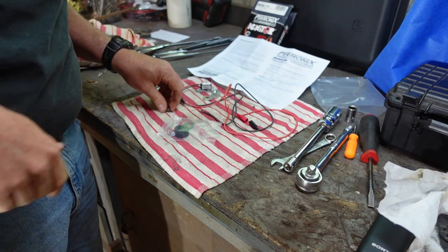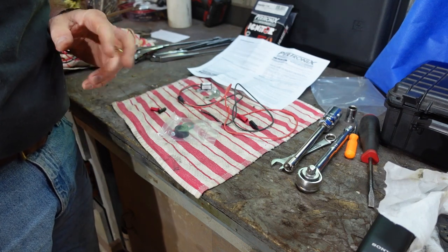Reading the instructions: 12-volt negative ground — I switched over my voltage when I switched to LED lights. Don't use solid-core spark plug wires. Incorrect wiring or leaving the key in the run position without the engine running for an extended period can damage the unit — I've heard that leaving the ignition on can burn the unit out. Four and six-cylinder engines require a minimum of three ohms primary resistance in the ignition circuit, so I'm going to check my coil. It is indeed a three-ohm coil, so that's good.